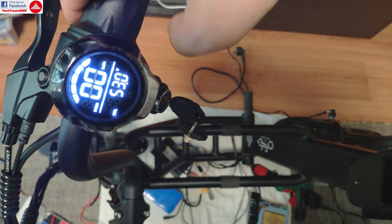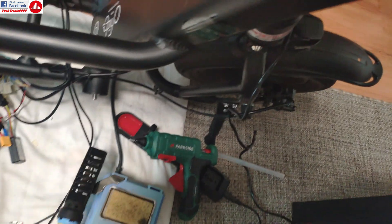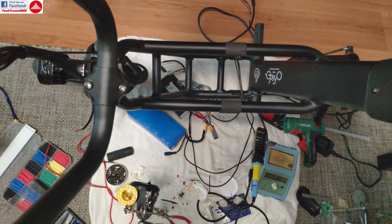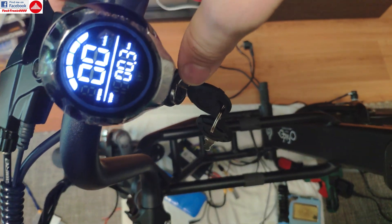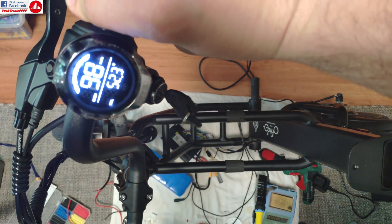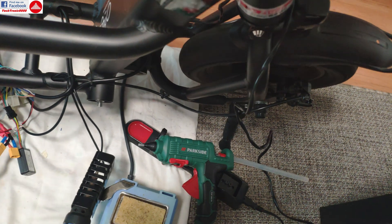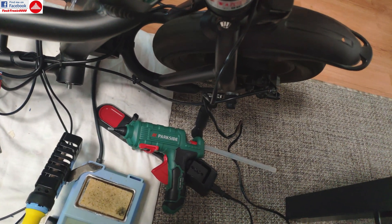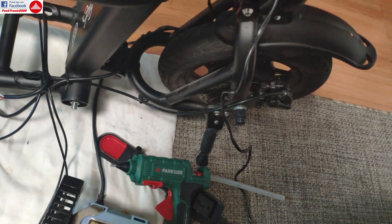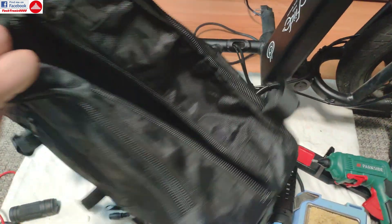The display is not calibrated so it's probably not showing the true speed, but you can hear the motor — it has a really nice sound and is definitely spinning faster than the old 25 km/h limit it had previously. Because this is a hub motor with gears and a freewheeling clutch inside, it doesn't put any load on the bike when you are coasting, which should be really interesting. Now it's time to fit everything into the back and install it onto the bike.